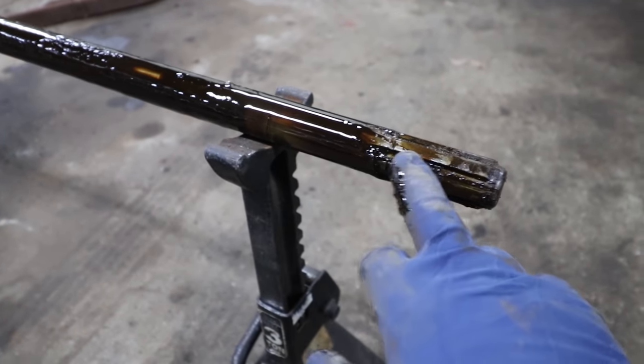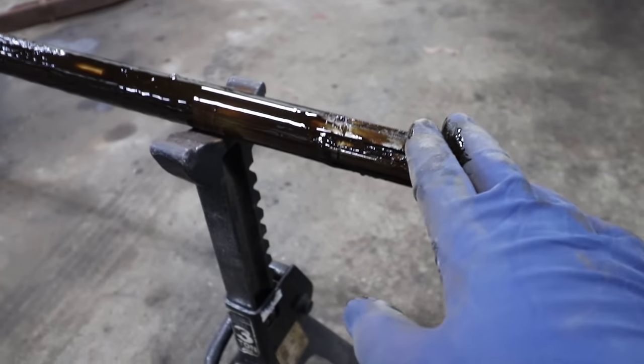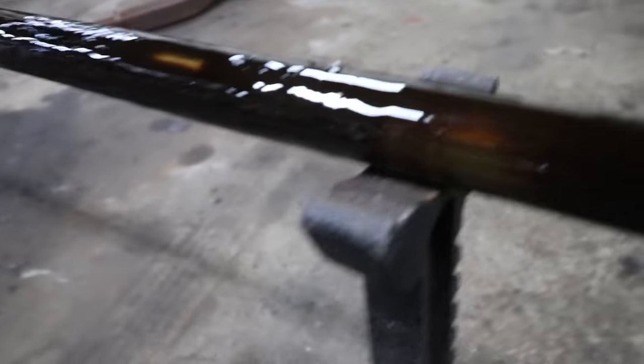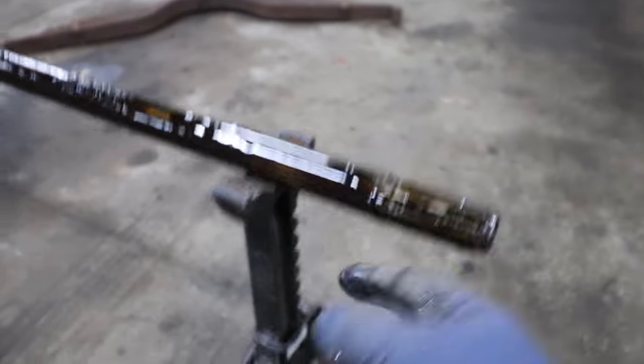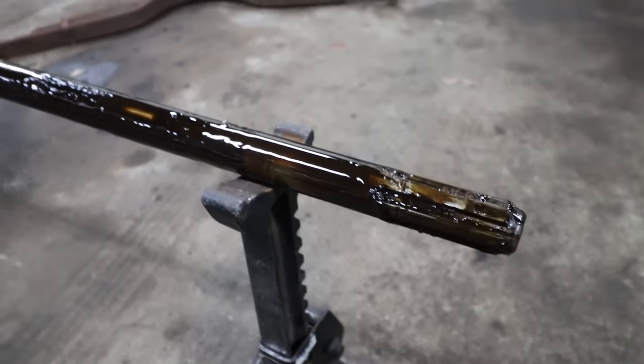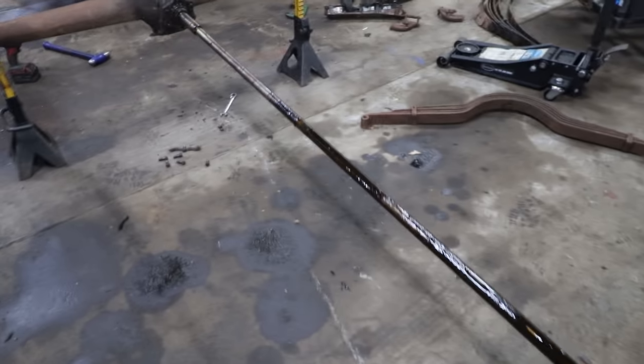And you cannot slide the torque tube off unless you take that circlip off, pull the gear rod, all that stuff. You pull all those pieces out, and this thrust washer, of course, sits against the bearing. So that's in there. So once you get this off with the circlip, then you can slide the torque tube off. And I don't care how hard you bang, that little wire clip is a lot stronger than you think. So make sure you check that.